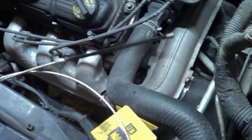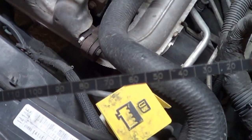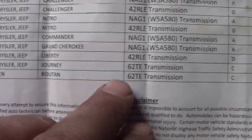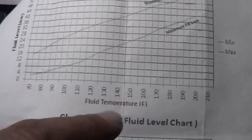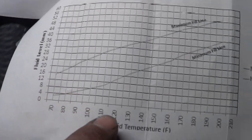Not only do I have the dipstick, I have instructions with it. You stick it down in there until the bottom is out in the pan and make reference of your millimeter reading. Here are the instructions — it does say Volkswagen Routan 9-11. There are different charts for different types of transmissions, and this is our transmission, the 62TE. At a given temperature, the fluid level should be at that millimeter reading.